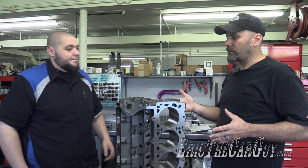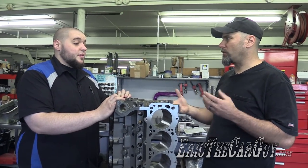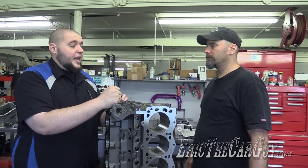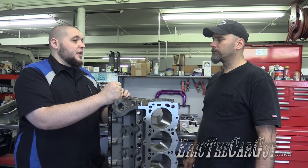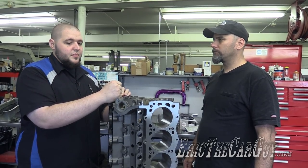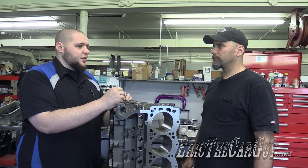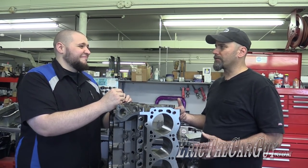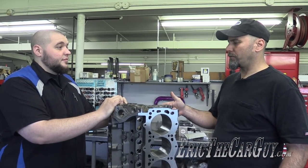Is that why sometimes you want different gears on your distributors with different camshafts? That's due to the cam material. The harder cam cores need bronze gears. The cast iron cam cores — the everyday stuff — use cast iron gears. The reason being is one gear would eat the other. And then that cam gear also drives the oil pump as well, right?